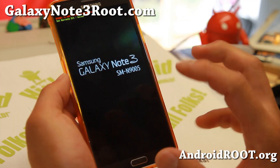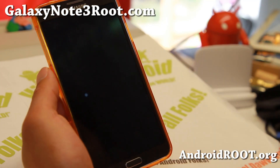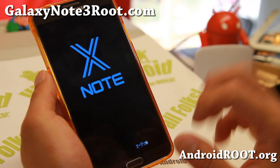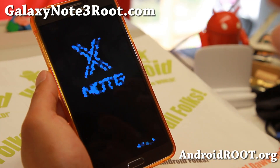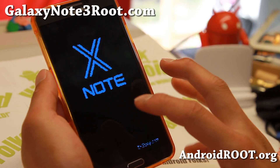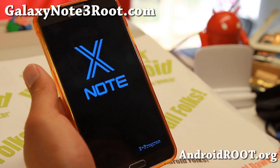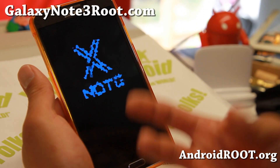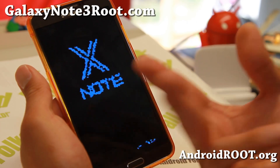Before installing your new ROM, you should have backed up at least one copy of your stock ROM so you can always go back to it. You can see I've got the XNote boot animation, which is the boot animation for this custom ROM. If for some reason you just can't boot it and you try the format system option and it still doesn't work, you can always restore back to your original ROM or whatever ROM you were on. That's the beauty of Clockwork Mod Recovery.